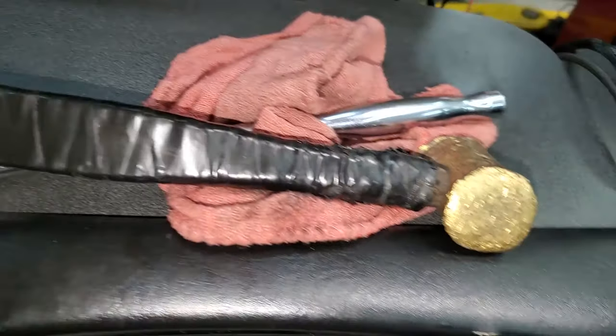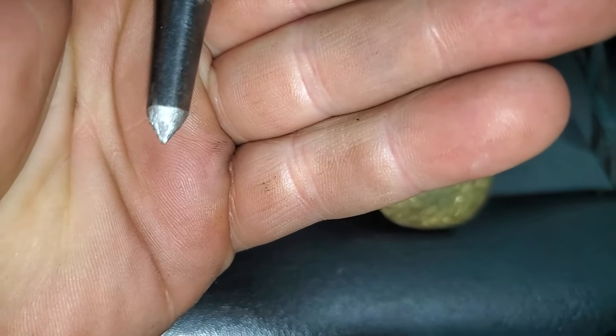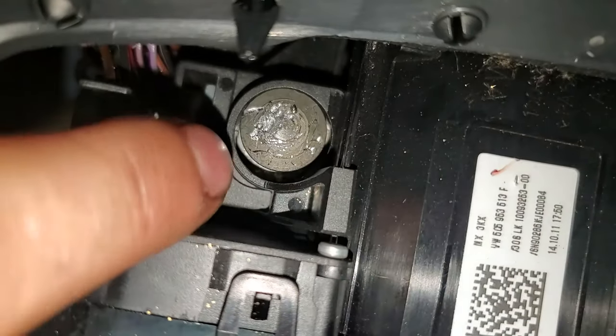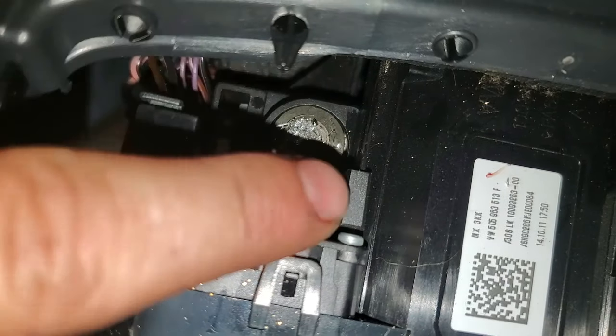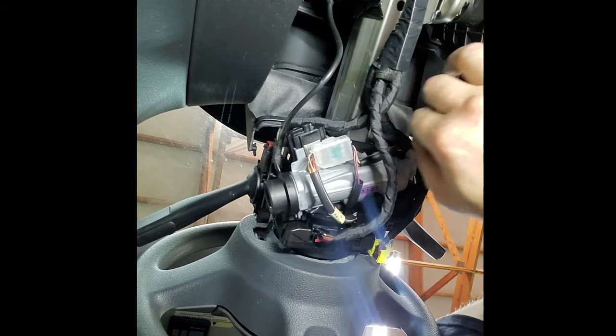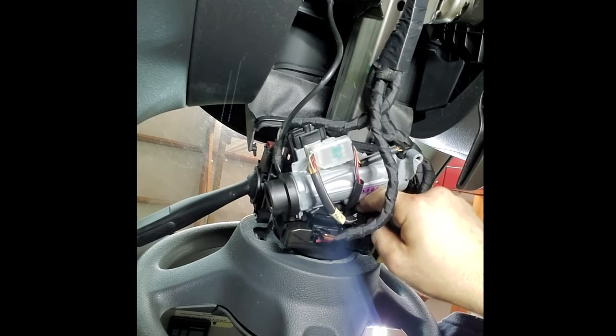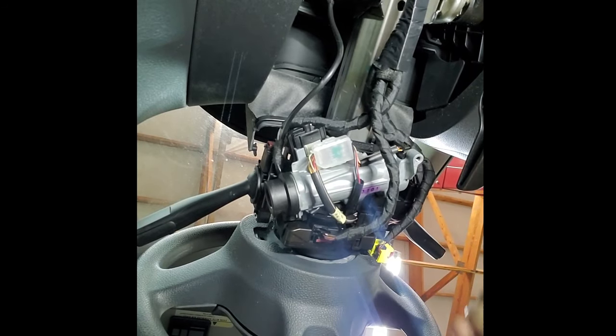It's a little easier with a punch — this one's got a nice sharp tip on it. You use that to dig into the bolt; you can see the little notches right there. You drive down and then at an angle and it'll come loose. We got the bolts out at the top now — let's see how much it's going to take to get this thing loose.